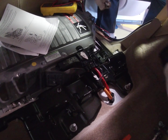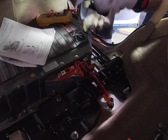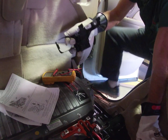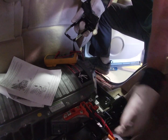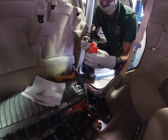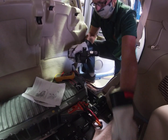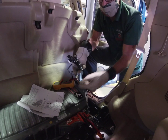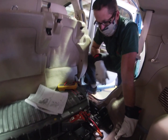Under this panel here there is a secondary switch, and the purpose of this switch is that if somebody left this cover out of the vehicle, the battery would not connect to the rest of the car — it's another precaution. So you have this plug here, and on the back side of this plug there's a sensor that has to be acknowledged as the plug being inserted all the way. Then you've got the same type of deal here — this actually completes the circuit because it's fully depressed from the top side. If the bolts are loose, you're not going to go anywhere. Safety, safety, safety is the name of the game.